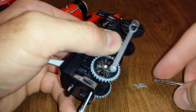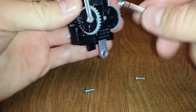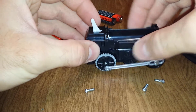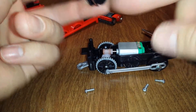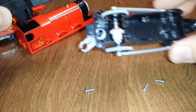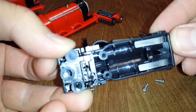This needs a triangle bit screwdriver to get the screws out — there's three of them. Now when you take this out, the switch will probably fall apart. I'm holding it in place with my fingers so the switch doesn't fall out. There's a white piece to the switch and a black bottom piece. Here's the motor — just a drop in, very easily switched. Just got to slide the gear off. There's the drive wheel gear. Seems like they lubricated that decently. I just dropped that motor back in. There's the terminals from the battery source.